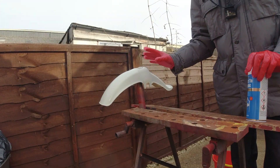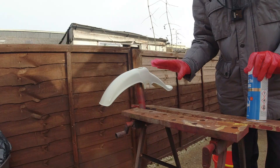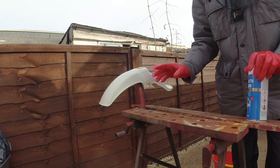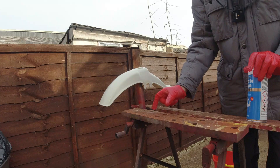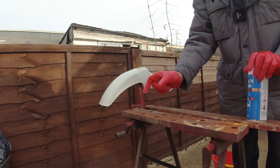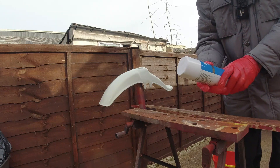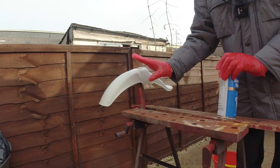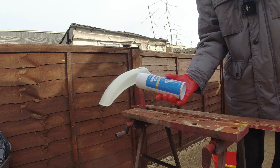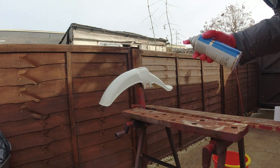I'm moving on because we can hopefully get this front section done. I have cleaned this front mudguard up and it's come up very nice, but it's still not brilliant white. I've ordered a leg shield coming from Holland and also a centre panel which is white as well, in between the legs. So I was a bit concerned that everything's going to look new and white, and yet the mudguards won't. So I've got some of this Rust-Oleum direct-to-plastic — it did have quite good reviews. I've sanded it down and it's all washed. Apparently it goes on in very light coats, so I think we just have to build them up.